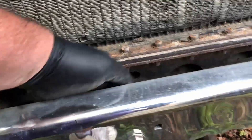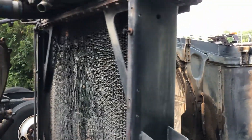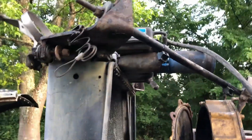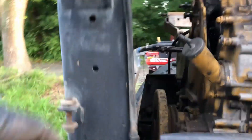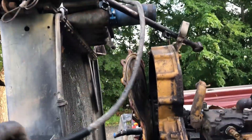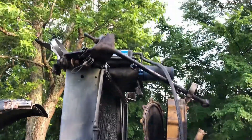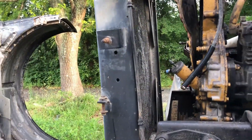So I guess now I'll start on the radiator. I know there's two bolts there - I think that's all that holds it on - but I've got to make sure there's nothing else connected to it. There's a ground over there which I know about, connected there that I've got to take off. This hose looks like it goes with it. This guy here is disconnected, the holder is disconnected. So it looks like I can probably just take it out of there.